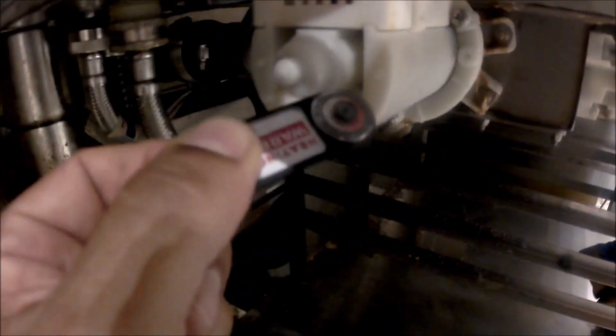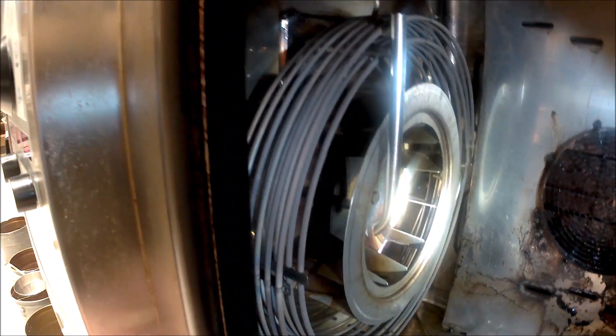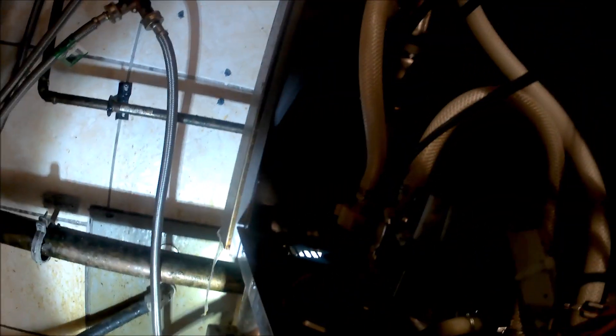Let's go run this wave clean pump. As you can see, with the door open it will not run — we've closed it. We put a magnet on the door here since the sensor is just below the door catch. We have no water flowing even though the quenching box is filled — there should be water flowing out of here. So either we have a bad pump or we have a restriction somewhere. Next we're going to pull off the tubing that goes from the pump to the cavity, see if anything's plugged, take everything apart, flush it in the sink and see exactly where the issue is.